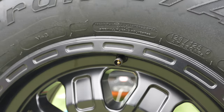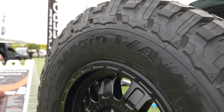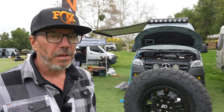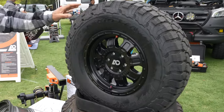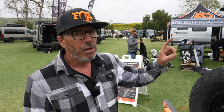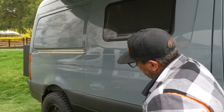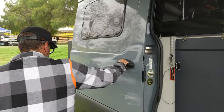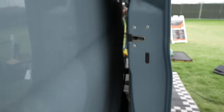It's got our logo on there — a huge valve stem. That thing opens up like a toilet bowl. It allows you to air up the tires and also air down the tires super fast using the same valve stem. The size of the wheel is a 17x8 with a 34mm offset. That 34mm offset allows us to run very large tires — this is a 285/75/17, and should also run up to a 35 for those with hybrid systems. It will work on the slide door with the door fully open. It does require our 1-inch spacer on the slide door, which we do offer. In some applications, this will not require wheel spacers on a lift kit.